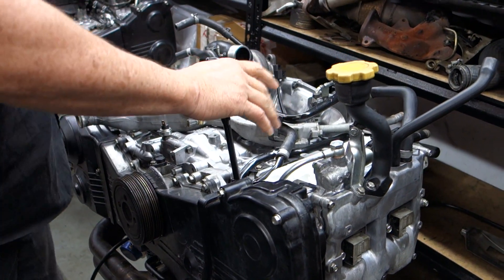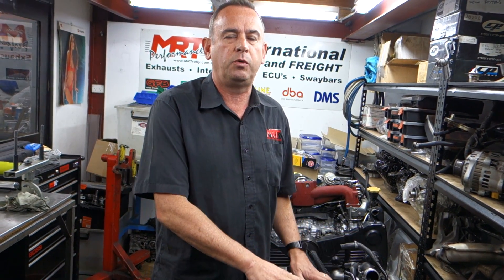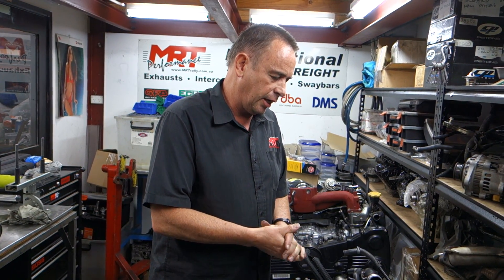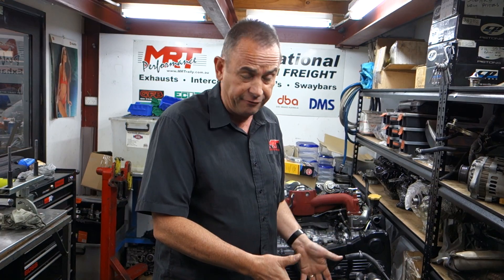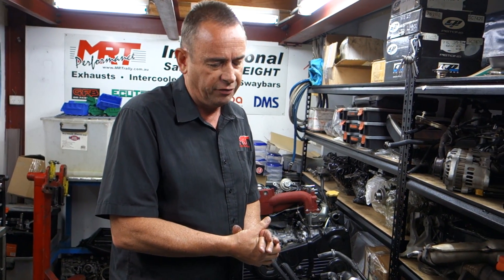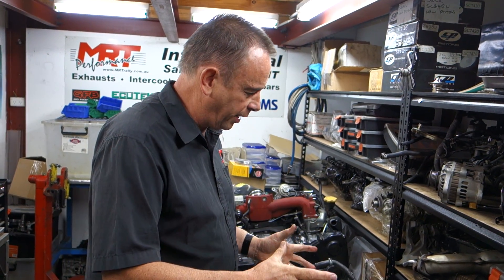This was the engine that had head gasket problems. The owner had lost confidence with the previous workshop - the way the engine was running wasn't delivering the power he wanted. He does drive the car pretty hard. It's in a WRX, not an FA series engine, an EJ series engine. The owner openly admits he drives the car hard, but he wanted peace of mind when it goes back together. Hence the overkill in the design spec - he was absolutely adamant we had to go closed deck to give him maximum reliability with his head gasket.